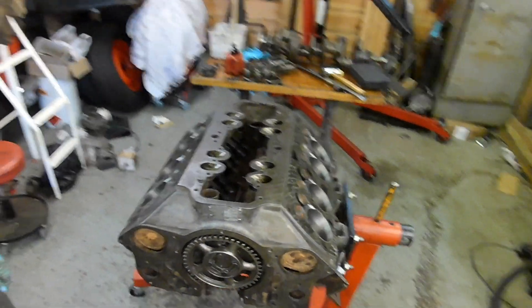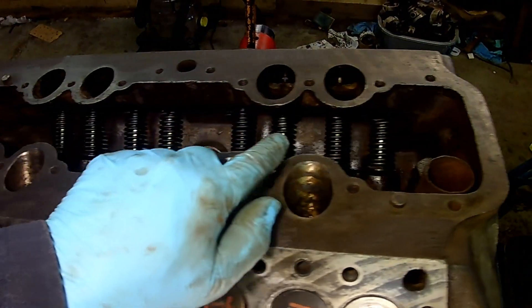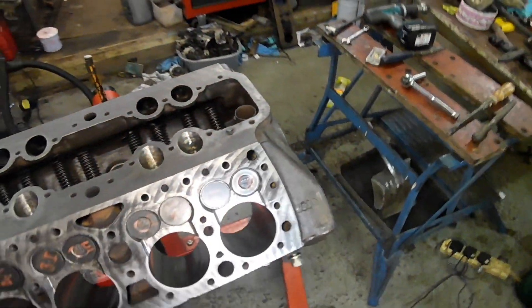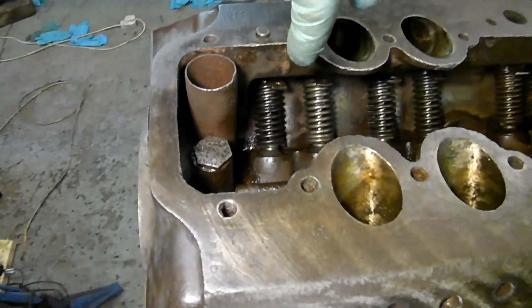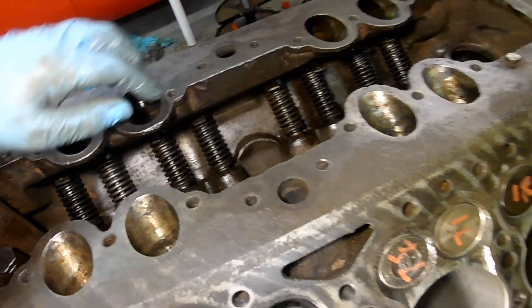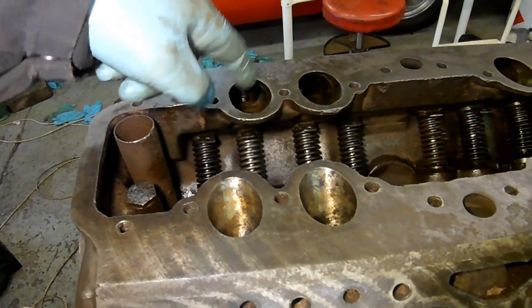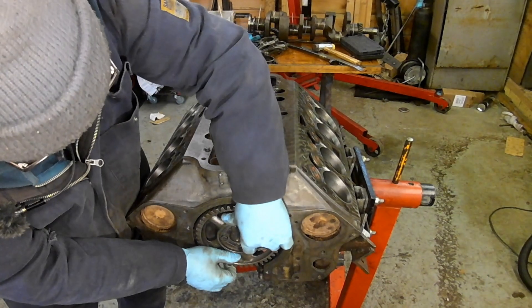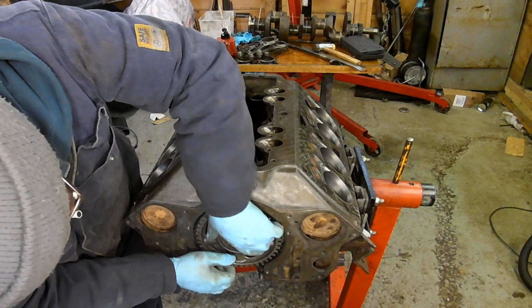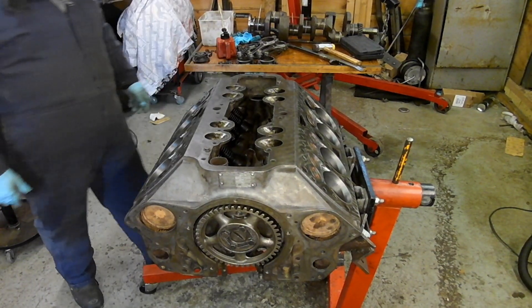Okay, I'll just show you inside. There, you can see inside. Just double checking that they're all in place. Now what you want to do is avoid turning the cam as much as possible — just do a full visual check that they're all in place. You can see down the guide, down the port there, you can imagine it pushing down on the guide. And then you only need to turn the cam to there, and that's in the right place to mate up with the crank — there's the mark. So that cam's only been turned once, and you want to avoid turning it any more than that.